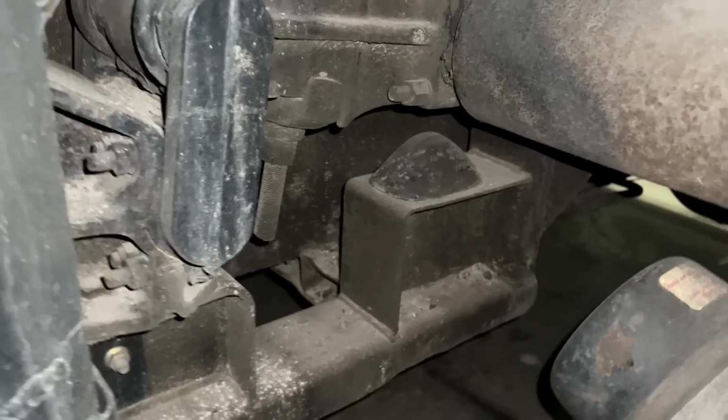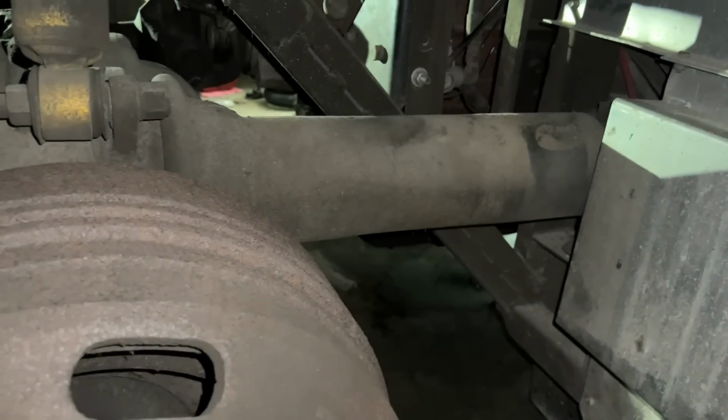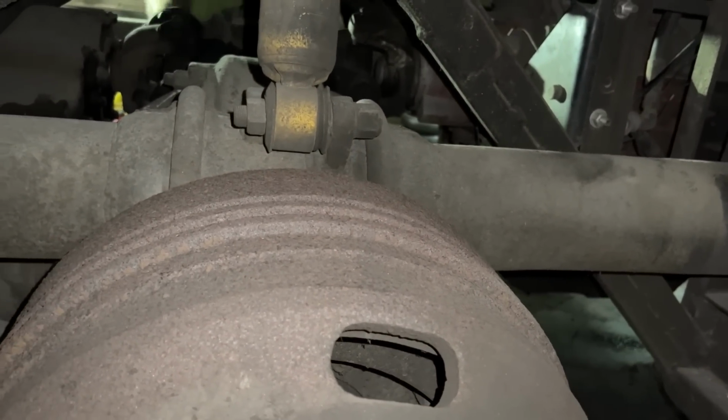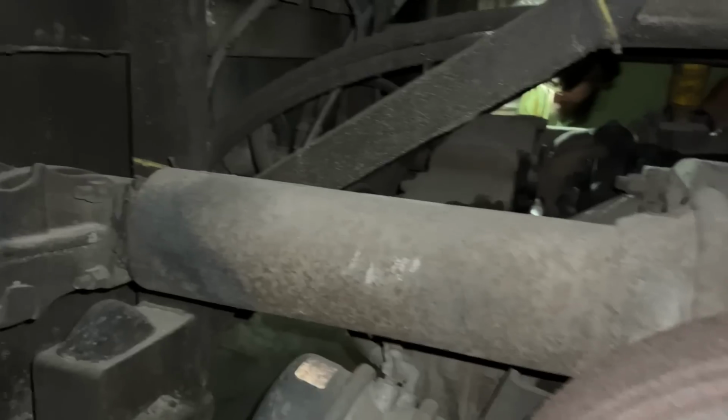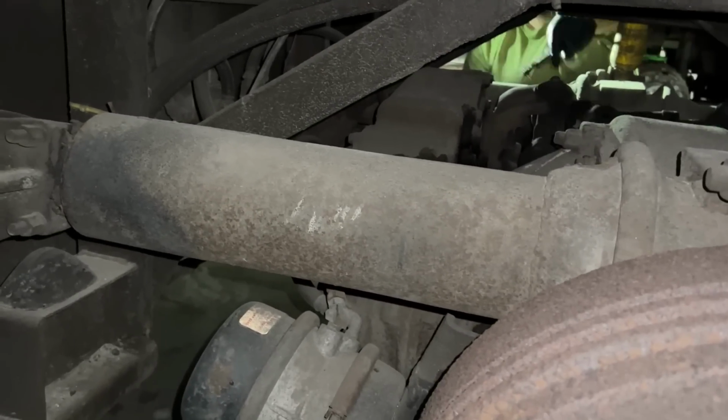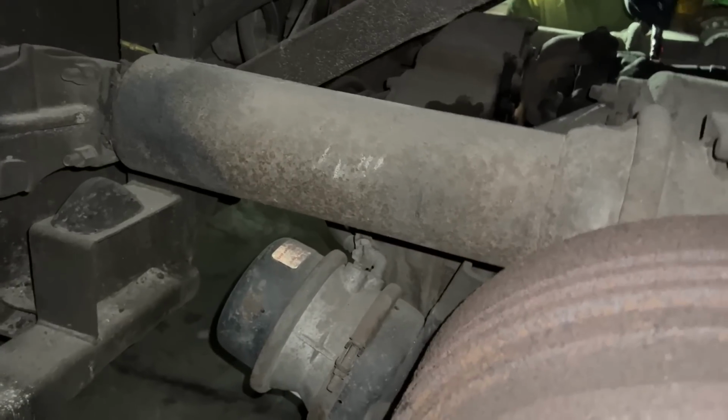And we'll replace the shackles. All the components that are on there will get replaced so that he'll have the new torsion springs on there, so then the bus will ride higher. You can adjust the ride height per those. So there's no airbags or leaf springs or anything. It's basically a big wound-up rubber band that holds the bus up. Mario Gallardo, that's his name.